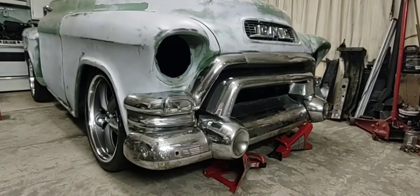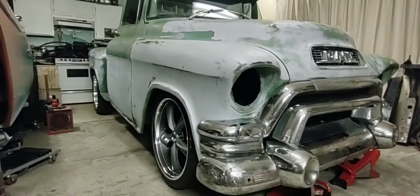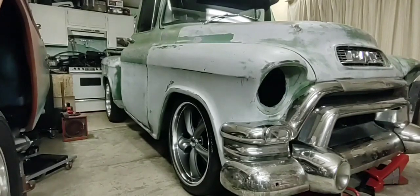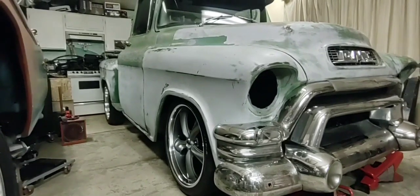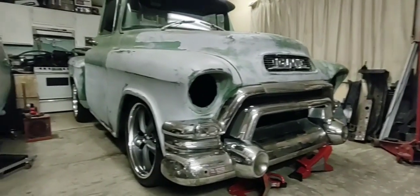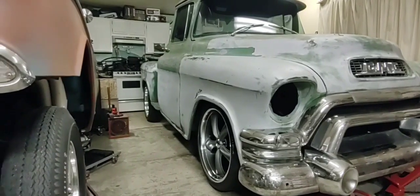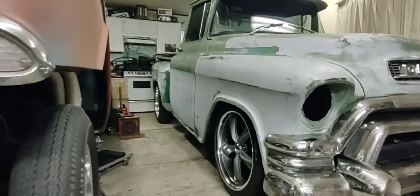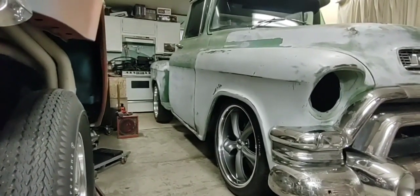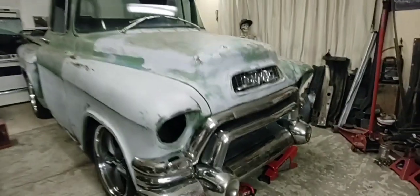The bumper needs to go down about another inch. When I put that engine in, I think that fender lip is probably going to come down to that wheel lip another inch, so it's going to be super low. I'm kind of digging this stance. If I do that axle flip and the two-inch lowering shackles, that'll give me seven inches of drop in the rear — she'd be super low.